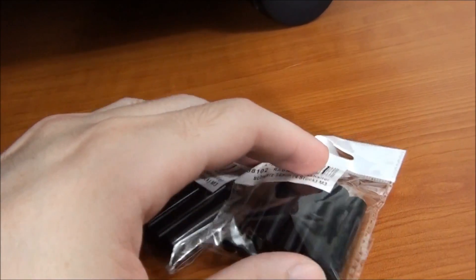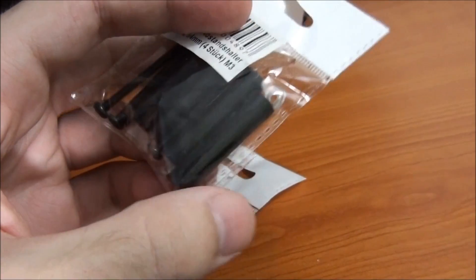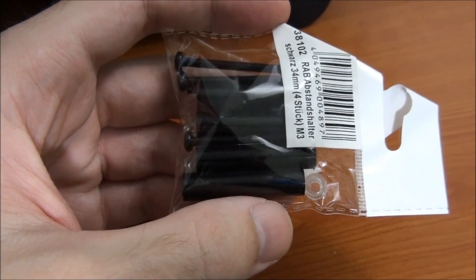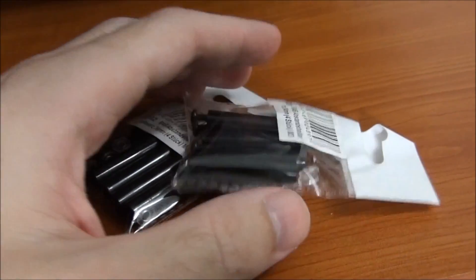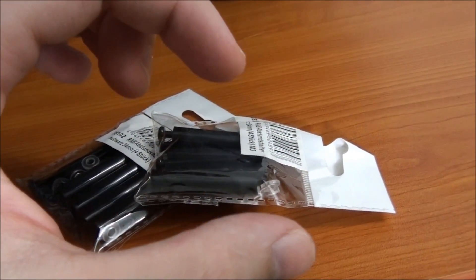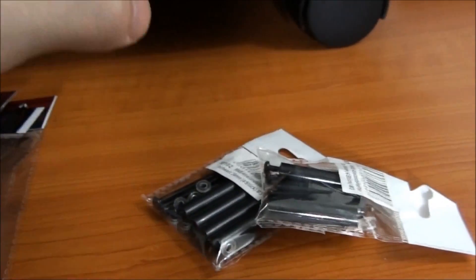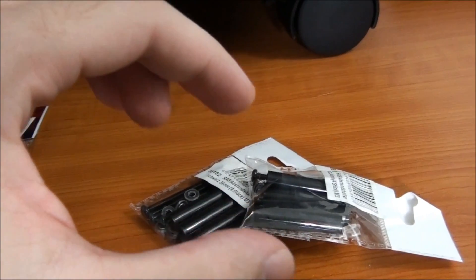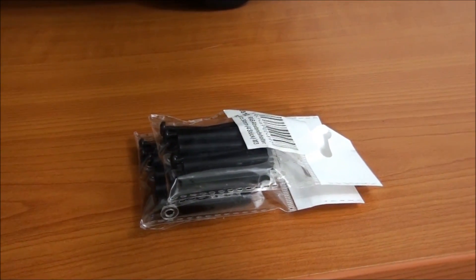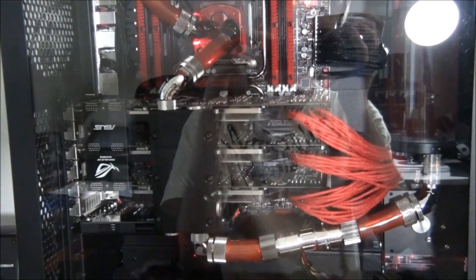Next up I have some radiator mounting components. There are four 34mm long M3 bolts and spacers. What these are actually for is mounting radiators up off a flat panel — so instead of mounting the radiator directly down onto the panel of your case, you put the spacers in between and lift the radiator up off it so air can get in between. You can exhaust down into the gap or suck out of the gap, so basically it means you can mount a radiator to a flat panel with no ventilation through it. That sums up this video — thanks for watching, please subscribe, like and favorite if you want to see more.